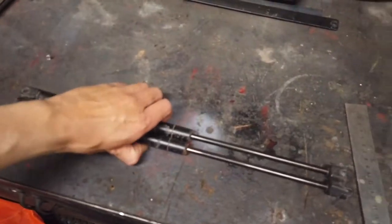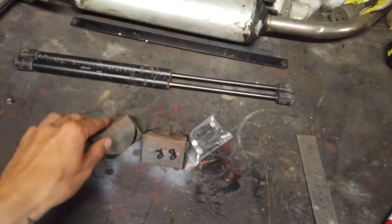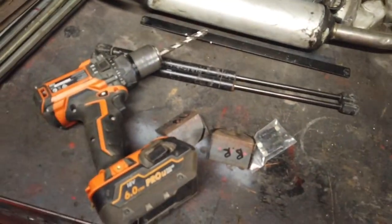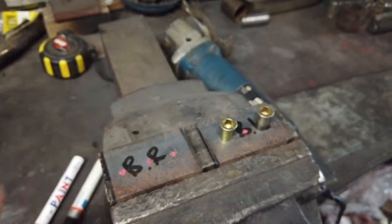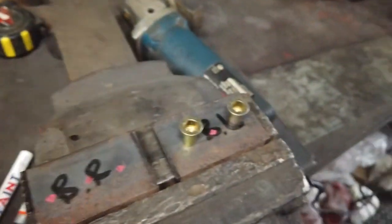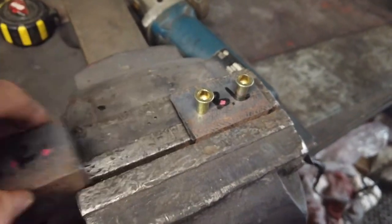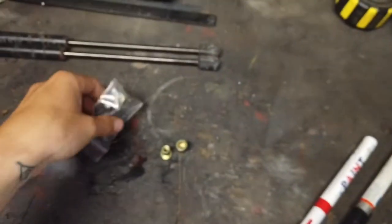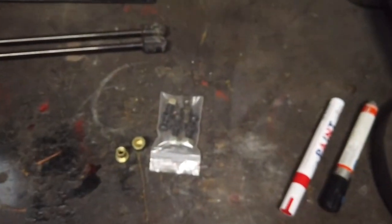In this video we'll dive into how to make the brackets, how to mount it, and where to mount it, so you guys can do it at home. Because we're still in lockdown in Melbourne and there's not much else I can really do. You'll need two L-brackets — find out where your centre is, then two points on either side so that pop rivets can go into your bonnet for the bonnet part, and obviously one bracket to go into the side of your body.